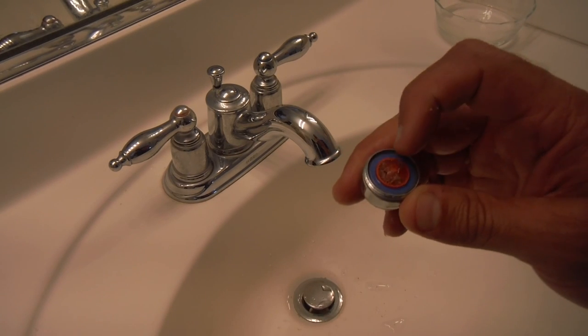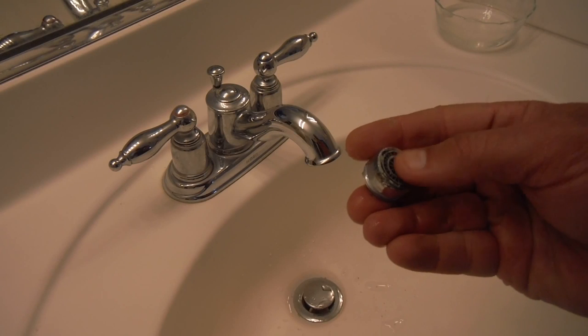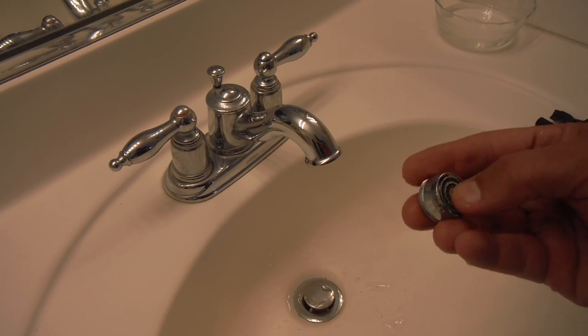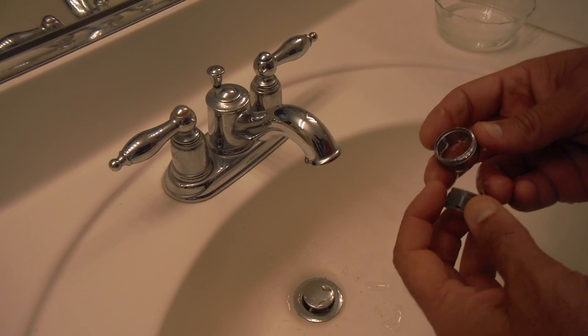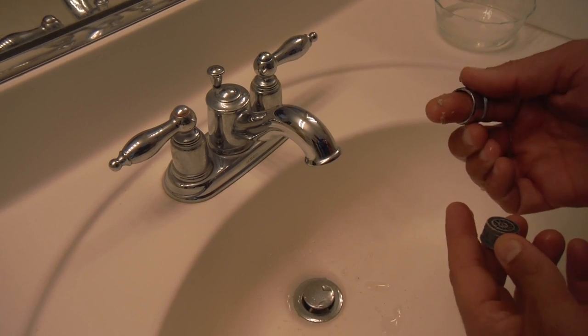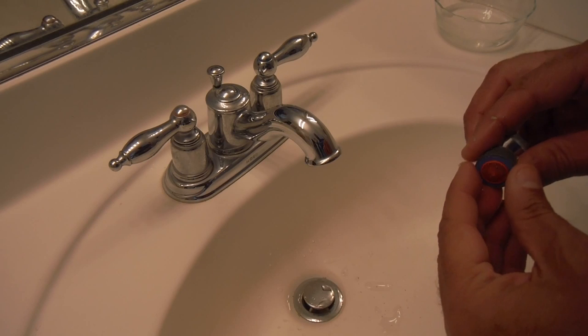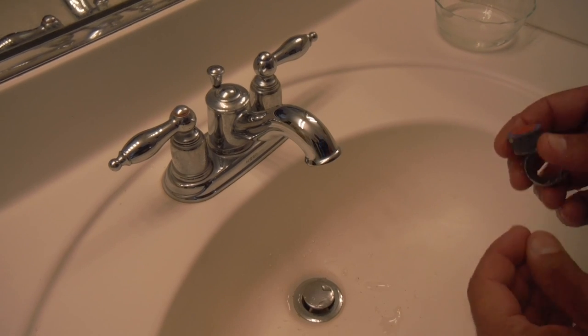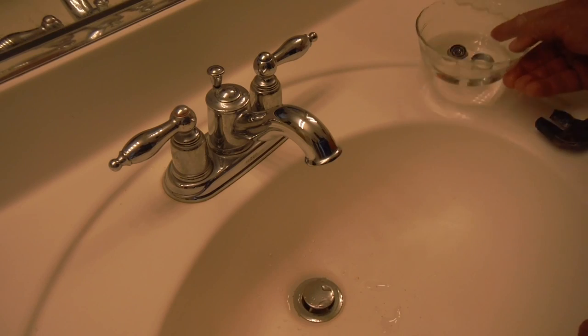You can brush that off sometimes pretty easily with a toothbrush. But to get this really cleaned up, I'm going to go ahead and take it apart — this piece will just come out. You can see this has got a lot of mineral buildup on the inside. We're going to take it apart like I just did here, and I've got a little dish of vinegar, and we'll just drop it in there.